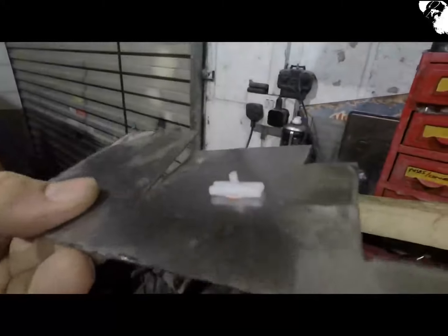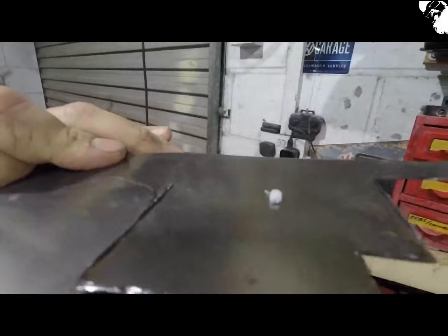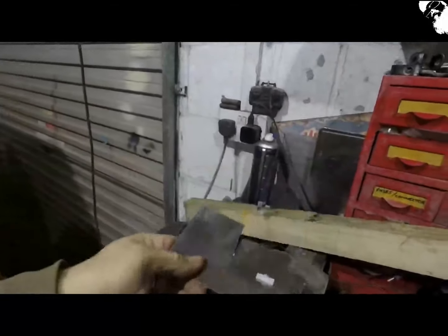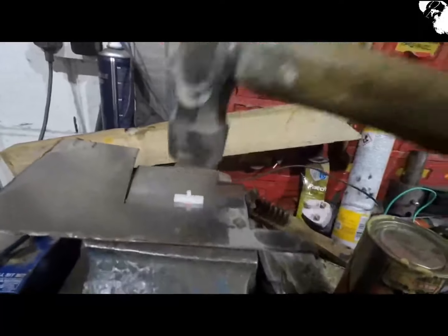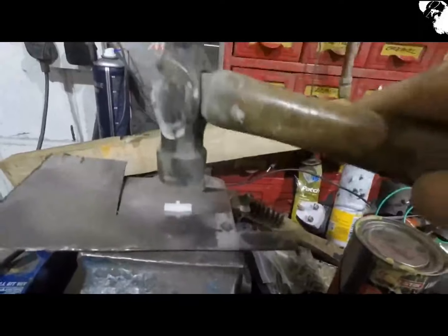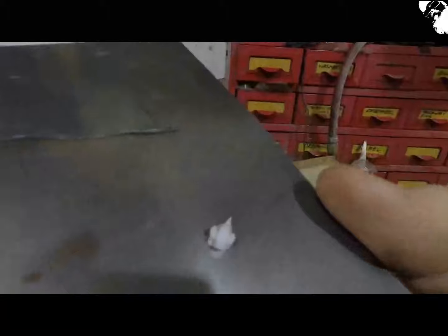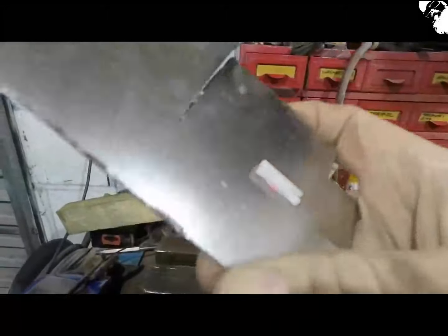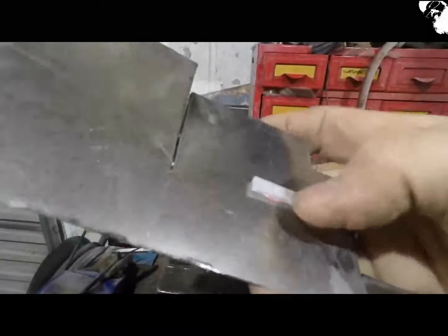There's the test fit - that's a 4mm hole and I've left the burrs on the back of it because there are obviously going to be some panels I just can't get up inside. I might be able to with a little file maybe, but at the time you hammer that peg down - that is going to be a good fit. See, it spreads the teeth open on the rear there. I'll go with that 4mm drill for the thinner style trim clip.